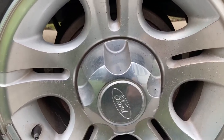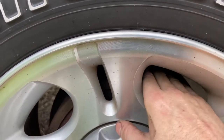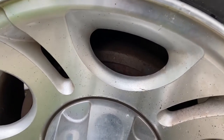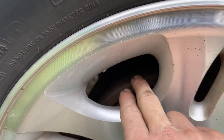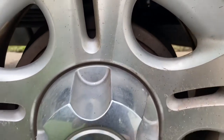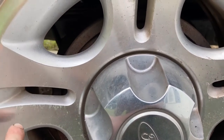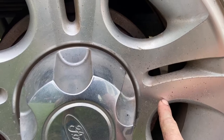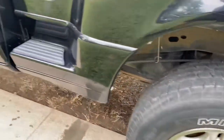And there's two different ways you can tell. You see how this drum is smooth right here on this portion? The 10-inch has that. Now you can see it's kind of like a perfect cylinder. The 9-inch brakes have little ridges, like little cooling fins, I guess, or structural ridges right here. Those are indicative of the 9-inch drums. The way that you tell for sure is you measure from the middle here to the middle there. It's probably better if you take the wheel off, but you measure from there to there. If you measure 9 inches, 9-inch brakes. If you measure 10 inches, 10-inch brakes, right?